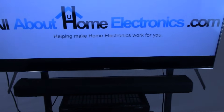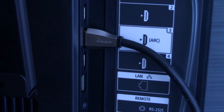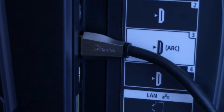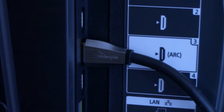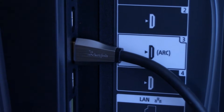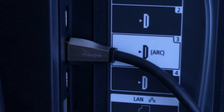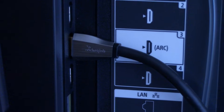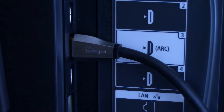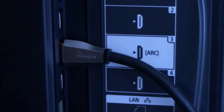The first thing we want to discuss is the HDMI connection itself, because it's perhaps the most critical. We've come around to the backside of our example television and we're zooming into the HDMI port we're using to connect to our audio equipment. People will say their television is ARC enabled but they're not sure if their audio equipment is, or their soundbar has ARC on it but their TV doesn't. The answer is no — you have to connect the ARC port from your television to the ARC port on your audio system.